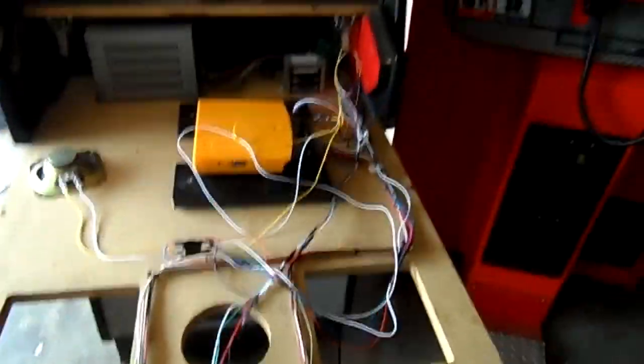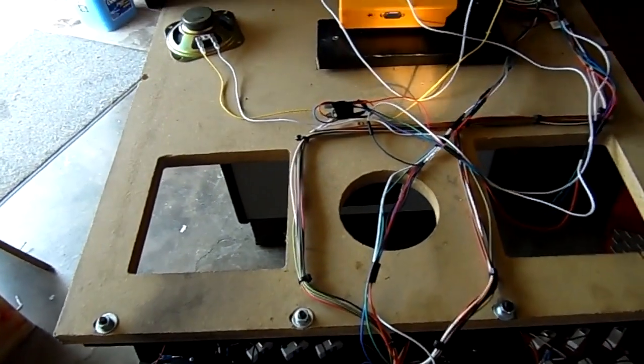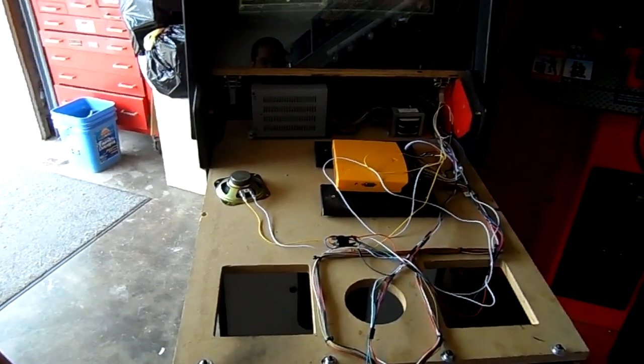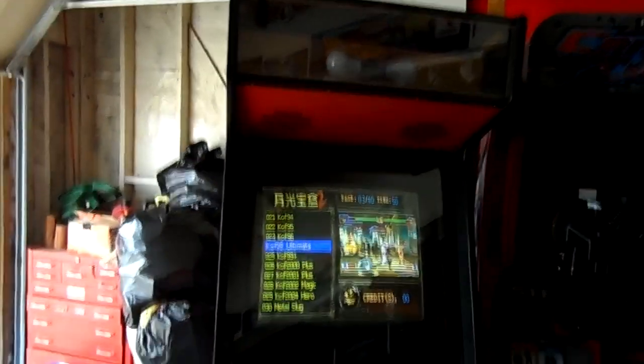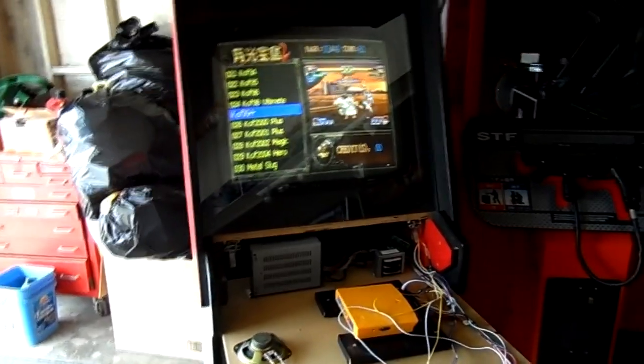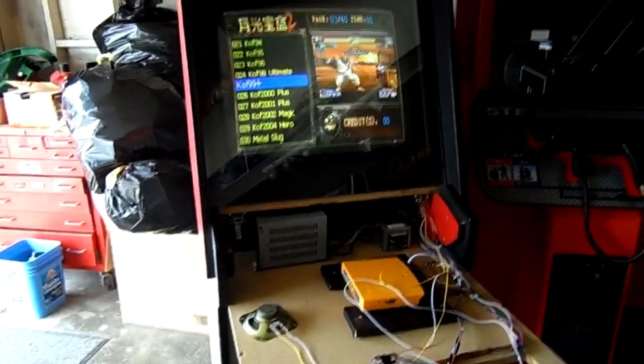So then I started tracing all the wires — something I should have thought of first, but it just passed me by. Looking at all the wires, you can see that a wire is missing. It was my 12 volts. For whatever reason, the previous owner — actually the second-to-previous owner — had disconnected the 12 volts. The person I got this from told me straight up there was a speaker issue, so obviously they didn't do it.